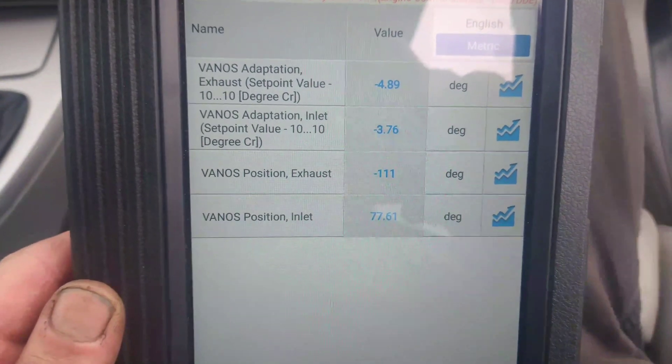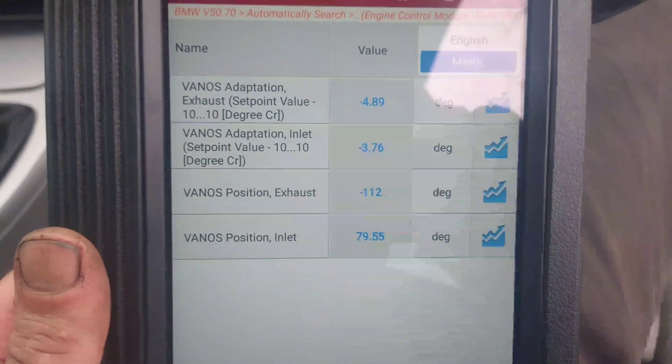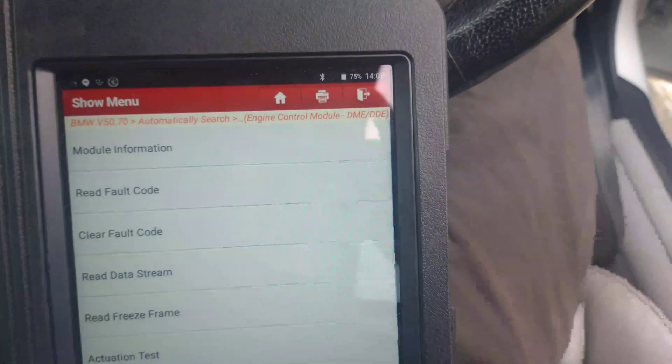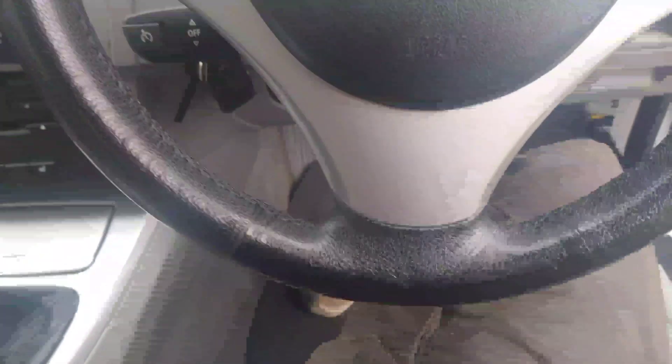Rev it up - wow, that soon revs up. This should go a lot better now judging by that. No fault codes - good. A couple of things to note though: when you're doing this, the chain's obviously stretched for it to be out of sync, so you need a new chain. And the bolts that you back off to adjust the timing are one-time-use only as far as I know, so they need to be replaced as well. This was just to prove what the fault is, and I think it's proved it quite nicely.